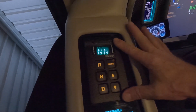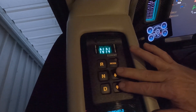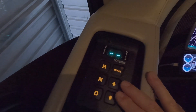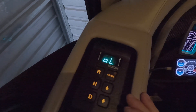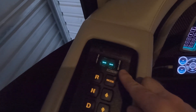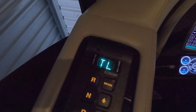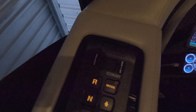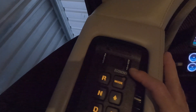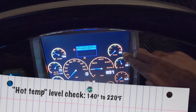Now let's walk inside the cab. On the Allison control panel there's a diagnostic mode, accessed by pressing both the down and the upward arrow at the same time and holding it. When you enter the diagnostic mode, if you see anything other than OL with an OK to follow, or perhaps an L2 or L3, that would indicate low fluid. In this case, TL is telling me that the temperature is too low. I walked in after it's been idling for 5 minutes, and indeed the transmission temperature is too low to do this readout — the hot temperature readout requires between 140 and 220 degrees. The trans temperature right now is 96 degrees, so we've got a ways to go.